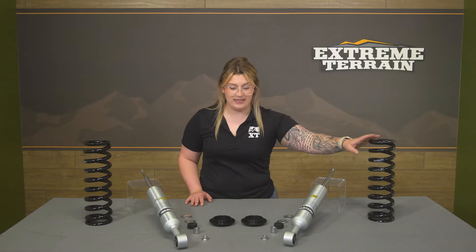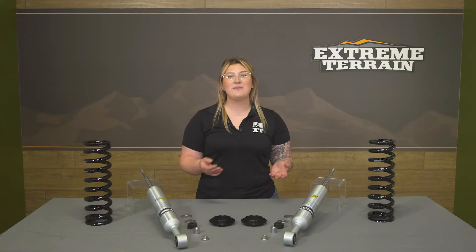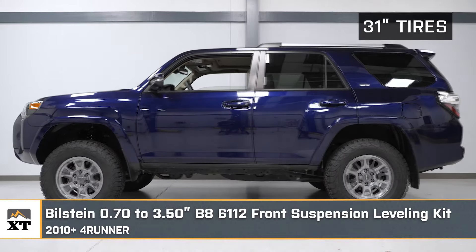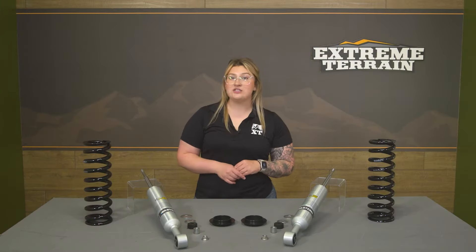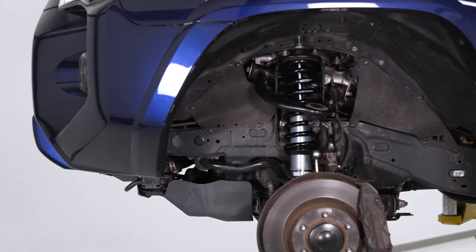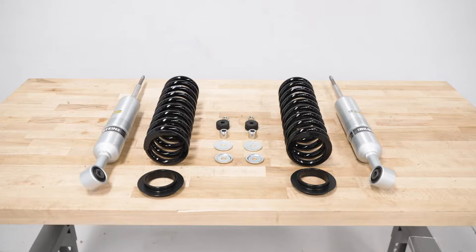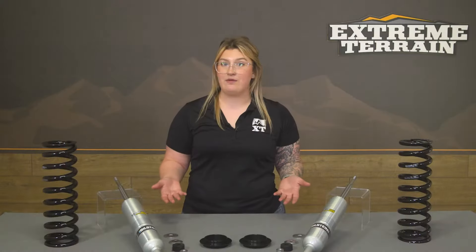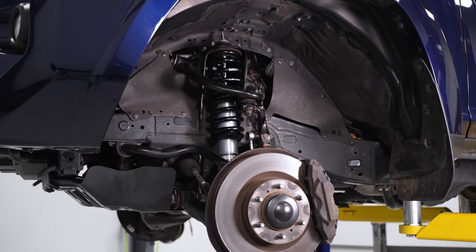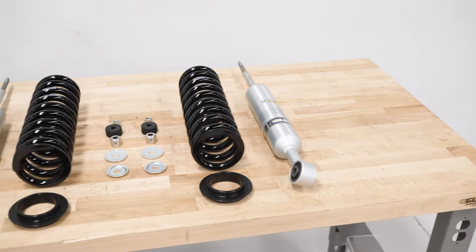You are going to get your powder-coated springs, as well as all of the hardware needed in order to make this install fairly straightforward. This will be pricier for a leveling kit, coming in at about $875, but for good reason considering that you're getting multiple heights and upgraded shocks with this. Comparing to other choices on the page, this is well-built and is Bilstein's bigger choice of shocks compared to their other 5100 series line. Other less expensive choices may not include the adjustability and may just be a factory-style replacement or a spacer, whereas this gives you better ride quality than stock and allows you to adjust your heights to multiple options.